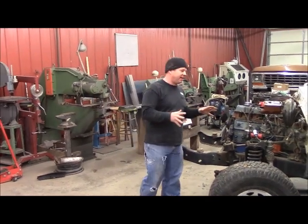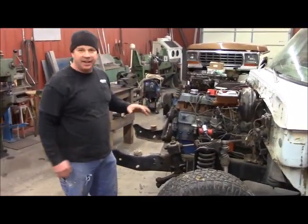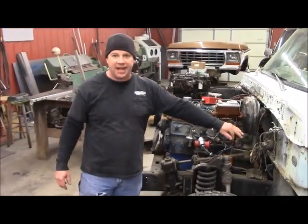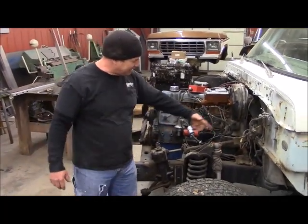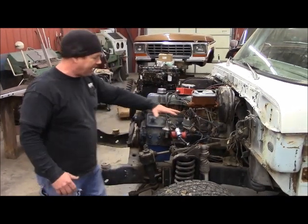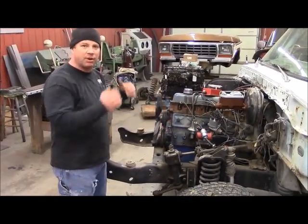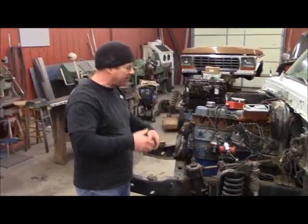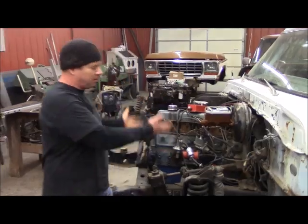Well Nathaniel, we got your truck in here. After studying the way your frame is done, I've decided to cut your frame up under the cab, past the last crossmember. This frame is completely boxed in all the way to that point, and then the I-beams that go back are locked in at that point. So I'll go right behind there — your frame is wide open, be easy to splice right there. What we're going to do today is pull your cab off and pull your motor off.